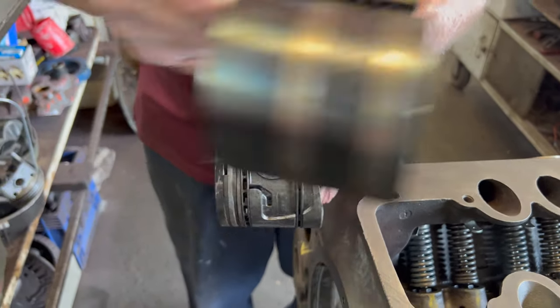When we get done with the motor, I have a stone brush and we always run it through here to buff out the block when we're done machining. That cleans the lifter bores and brushes all the debris out of the seat area before you start assembling the motor and grinding the valves.